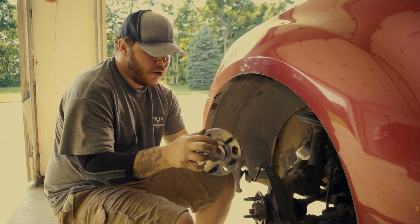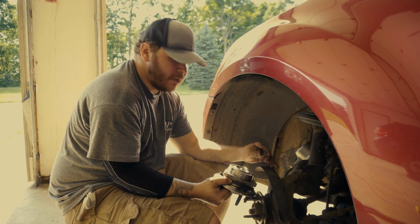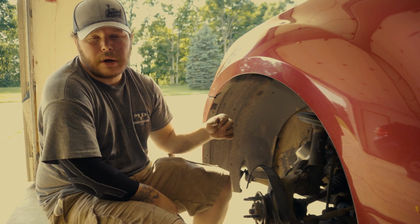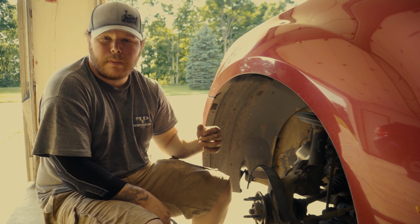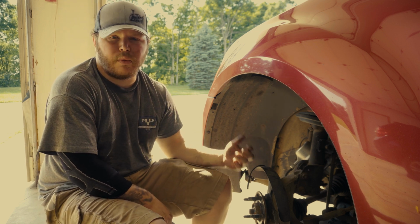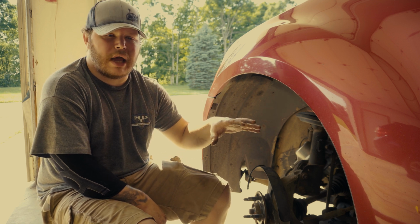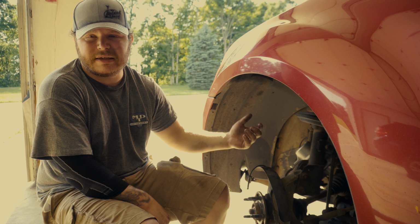As your wheel assembly spins, your ABS sensor is reading this magnet, which tells your transmission or the TCM what RPMs you're running at, when to shift gears. It also controls your all-wheel drive, your traction control, your assisted braking, your ABS, basically.